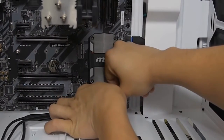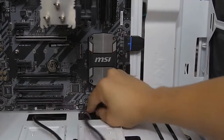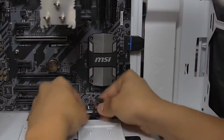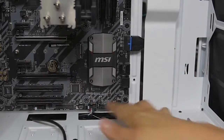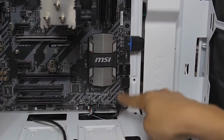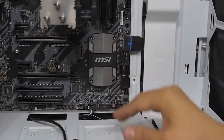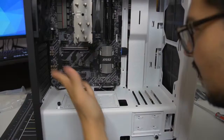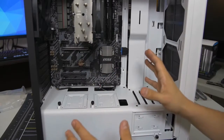The hard drive LED connector is on the bottom — it's a pain to get to, but all the small connectors are now plugged in. Moving on to USB 2.0, which is right next door and also keyed. If one of these pins snaps off on any header, you're in trouble. Then the HD audio connector — front panel connectors are fully installed.